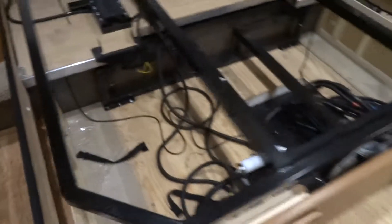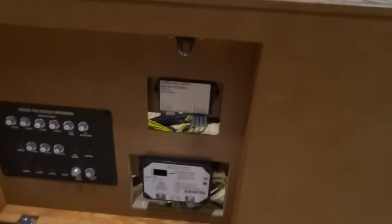Some of the wiring might have to be extended. Custom builds like this, you uncover a lot of wiring controls. This area here is a slide-out — a raised slide-out for the bed — it comes off the floor about eight inches. We have these breakers and a complete fuse panel down here where all your AC breakers are that we have to relocate. Because this was a raised slide, all of these controls are above the floor rather than down in the compartment bays. If this would have been a low slide, all the controls would have been hidden. So this poses a few more challenges for us to hide all this wiring.